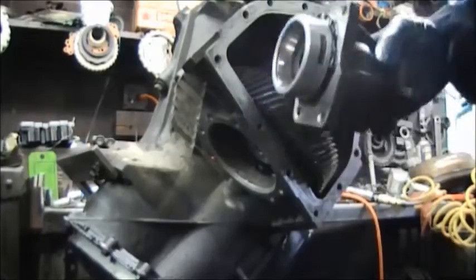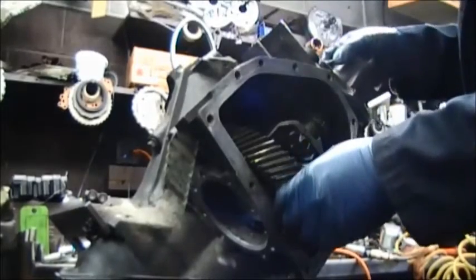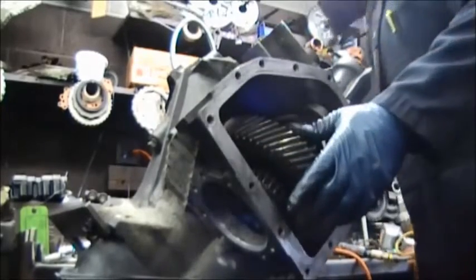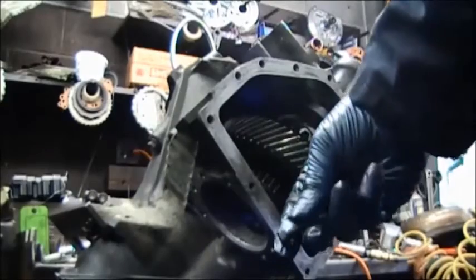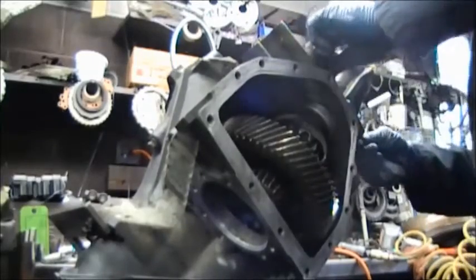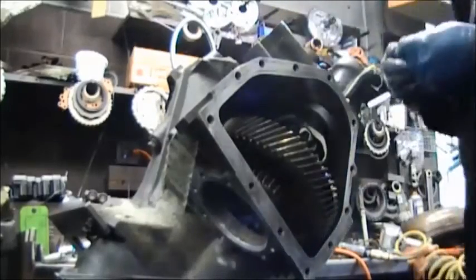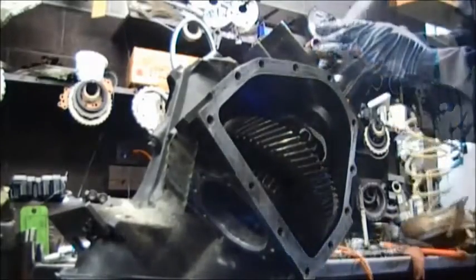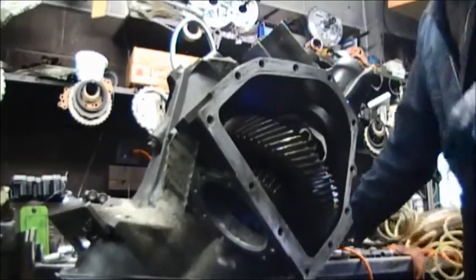And debris, there's the nose cone, so you put that on, but debris plugs up those little gaps in a solid pin, between the shaft pin and the spider gear, over time. And once it gets blocked up, then there's no oil flow. So that shaft pin eliminates that by allowing wider gaps there, so debris can just go straight through, and oil can continue to go through, and the spider gear can rotate on that oil. Okay, right now we're putting on that nose cone, putting 2 bolts in there, I guess.